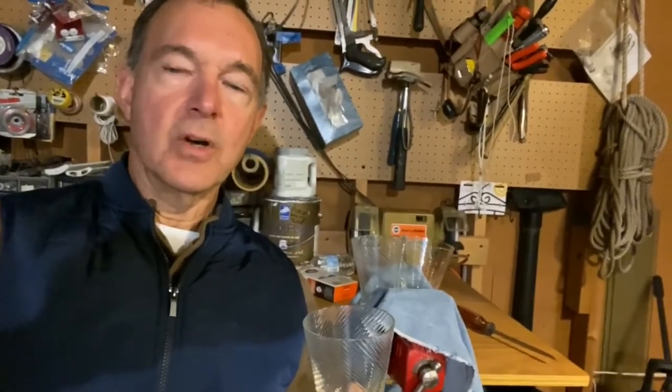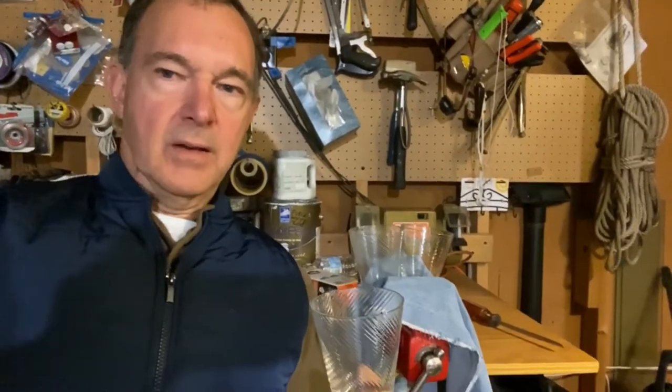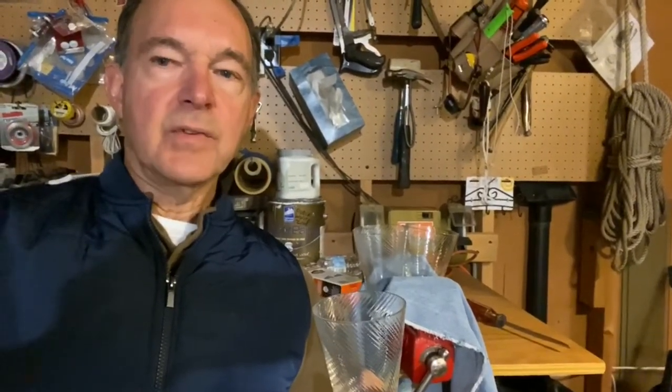Other things: put your dishes in your dishwasher dirtier — don't rinse them. The more dirt that goes in, the dirt will use up the causticness and results in less etching, less caustic reaction available to dissolve the glass.